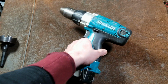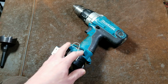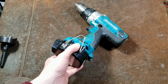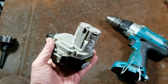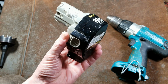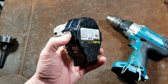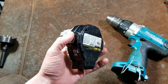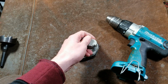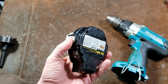You should also remember that Makita was the first to market with nickel metal hydride powered cordless tools, and they were first to market with lithium ion. They were really pushing that. Unfortunately, their push with these nickel metal hydride batteries, they were terrible. They would work pretty good for a while, but after 6 months to a year, they weren't the low self-discharge type. Those hadn't come out yet. Those types of nickel metal hydrides came out right around with lithium ion, so they just never got traction. And if they had low self-discharge batteries, these things would have been incredible.